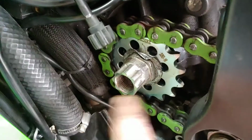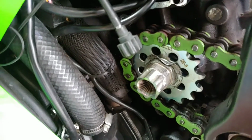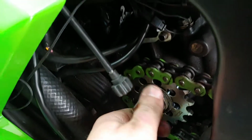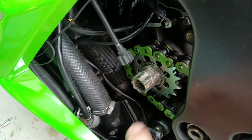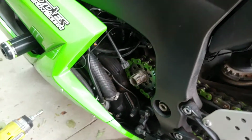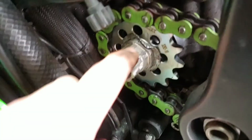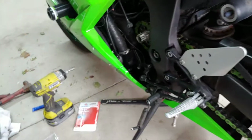Alright, so we got our front engine sprocket installed and its torque spec. The torque spec for it is, I think, 94 foot-pounds. I'll have to double check and I'll put it in the description. And when you tighten it, it's going to be wanting to spin, see it? So have someone hold the rear brake, and you can tighten it with the torque wrench to 94 foot-pounds. Or if you don't have anybody else, you can put the bike on the ground and tighten it. And also don't forget to bend your safety washer back down.